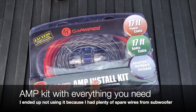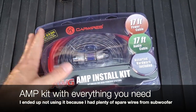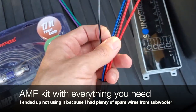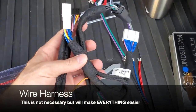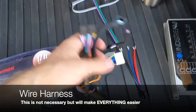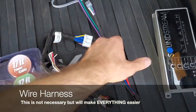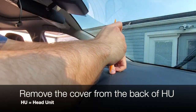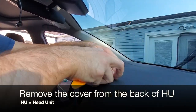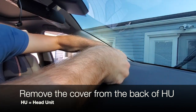This is a typical amp wiring kit used to power a variety of amps. What matters is the gauge size of the wire and the fuse. This is the wire harness kit we will use. It is meant for the latest model Camrys, but the head units are very similar to the RAV4, so they should be compatible. The first thing we do is access the wiring behind the head unit to confirm that the wire harness we purchased matches our head unit.